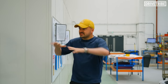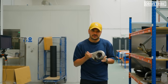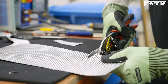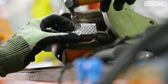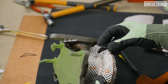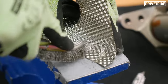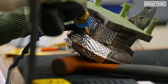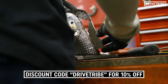The coating is suitable for applications up to 1,400°C and reduces exhaust surface temperature by 33%. That helps bring down the temperature of the engine bay — reductions of over 50°C are possible — which in turn lowers intake temperatures and increases engine power. The layer of coating is just 0.3mm thick but provides an incredibly effective thermal barrier, keeping heat within the exhaust system so gases stay hotter and flow more easily, increasing the efficiency of cylinder scavenging — the effectiveness of getting exhaust gases out of the cylinder — which helps spool up the turbo faster. By keeping heat within the exhaust system it also prevents heat soak, protecting fragile components around it. More reliability and more power.